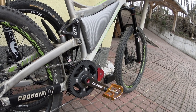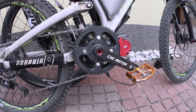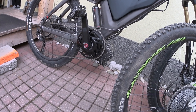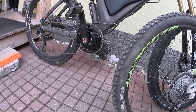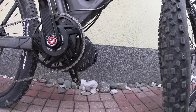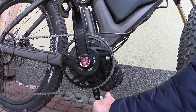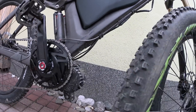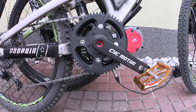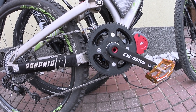These are the original cranks — some improved lightweight versions will be available later. They are a bit heavier than the original Bafang ones. Here are the Lecky ones mounted, which are also a bit heavier than the originals but with more strength. As you can see, the motor is under the chain wheel — this is a 46T and could touch the chain wheel itself. On the CYC, the motor is much higher, but the drivetrain has a big size. In the chain version it will be a bit smaller.